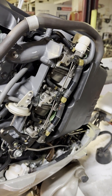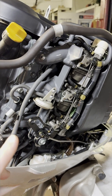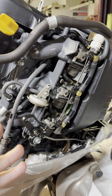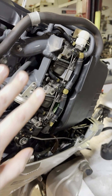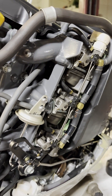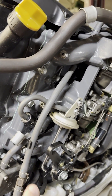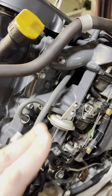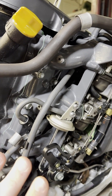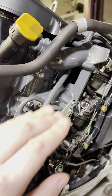The shop tuned and cleaned the entire setup so that it would run optimally again. What we did was we used the thermal imager to confirm that the fuel-air mixture is equal or nearly identical between all three cylinders. If we look at the carburetors, each of them can be independently adjusted. They're designed to be fully synchronized, but in order to verify that they are as optimally tuned and synchronized as possible, we can look at the cylinder head ports when the engine is running and fully up to temperature and see the differential in temperature between each port. If they are nearly identical, then we know that the engine is synchronized and tuned well because there should be minimal to no variance between each of the three cylinders.